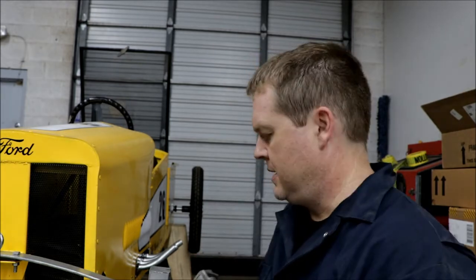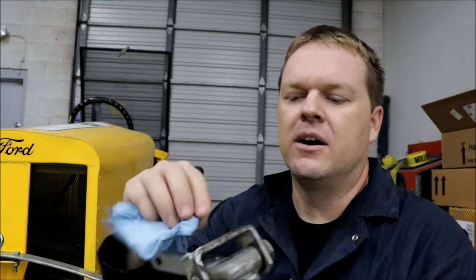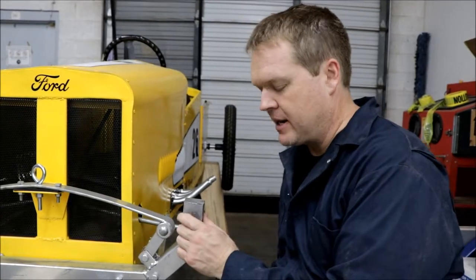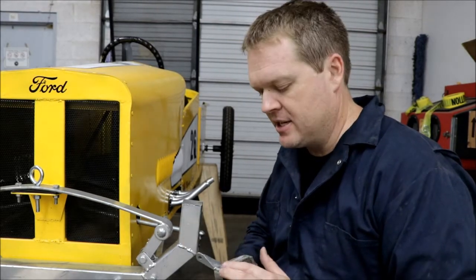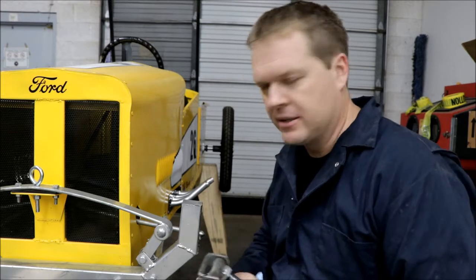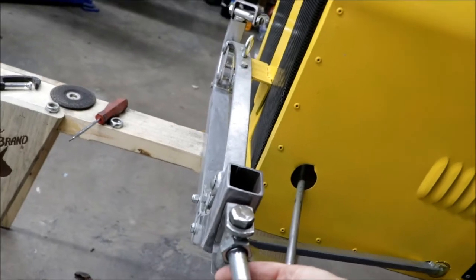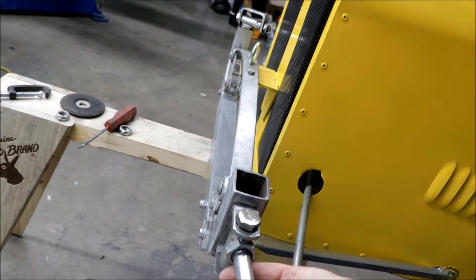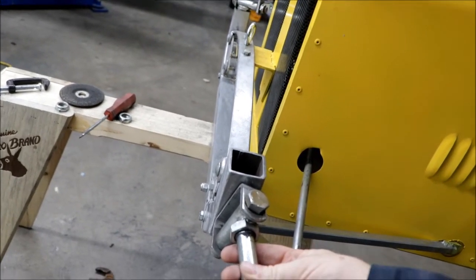The spindles are off. I've got a new respect for Lowell's welds on this thing — I had to use a new cutoff wheel for each one, and it took about 15 minutes a piece to get them cut off. But as you can see, they're still clean; I can clean all this up so they're completely reusable. Even this pipe here — I didn't even cut into it, I just cut basically all weld and beveled the edge, which is fine because I'm going to weld this back on. We're going to go from perfectly vertical to about right there.